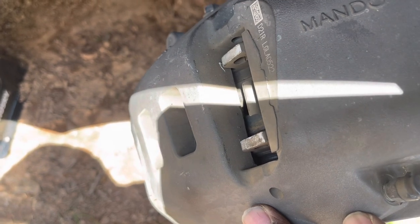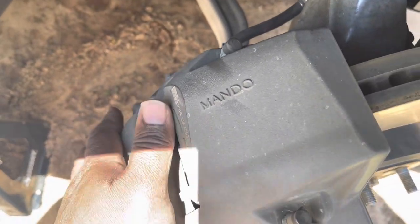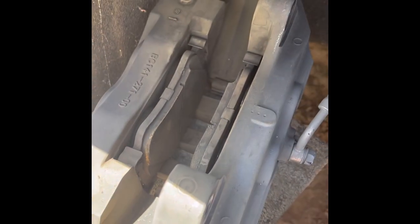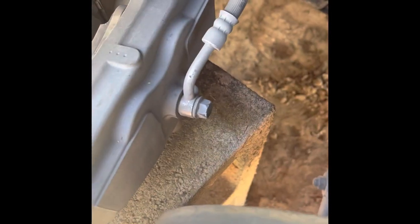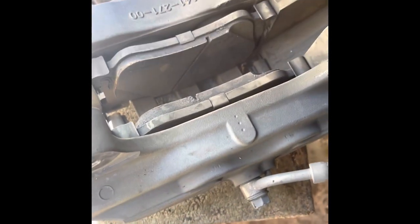The other Genesis G80 is made differently — it's got like a cage right here, and you remove that plate and just slide the brakes out. But this one is made totally different; it's a big bar. I got everything loose. I didn't loosen the brake loose — I just took the whole thing off. See that bolt right there and that bolt right here — they're 17-millimeter bolts. They go right there, one up top and one further down. Take them loose and you should be able to see the brakes.